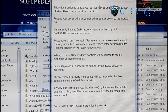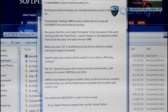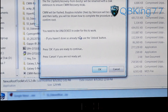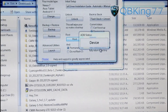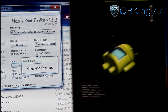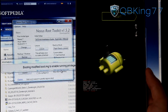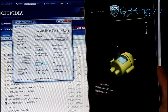Go ahead and hit the Root button. It gives you information about the script — it's going to root your device and permanently flash ClockworkMod recovery. Do everything at your own risk. You need to be unlocked for this to work, which we've already done. Hit OK to continue. It checks ADB, recognizes the device, reboots into the bootloader, and we can see lock state: unlocked. It checks Fastboot, device is recognized, then boots the modified boot image to enable privilege commands, and proceeds to flash ClockworkMod.